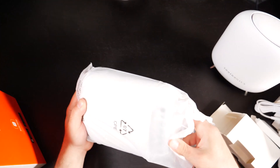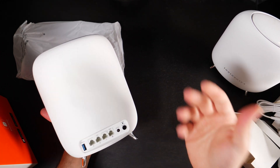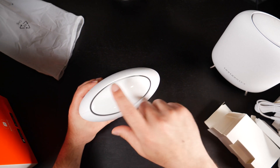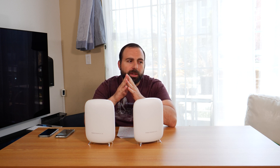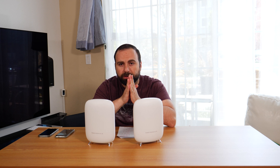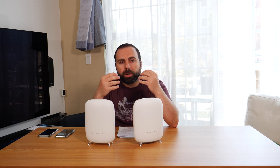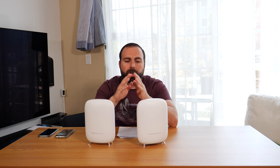Shape-wise, it definitely looks pretty nice. They both look like routers — obviously one of them is going to be a router and the other one is going to act like an access point, even though they are both routers. I've been running this thing for a week after unboxing, wanting to see if there were going to be any drops in connection or anything out of the ordinary. So far, so good. The only problem I ran into was during initial setup when connecting to my modem. The instructions say to turn them on at around the same time — that didn't work for me. What worked was turning on the router first, waiting until it blinked green, then turning on the modem. After that it connected to the internet no problem, and it's been running great ever since.